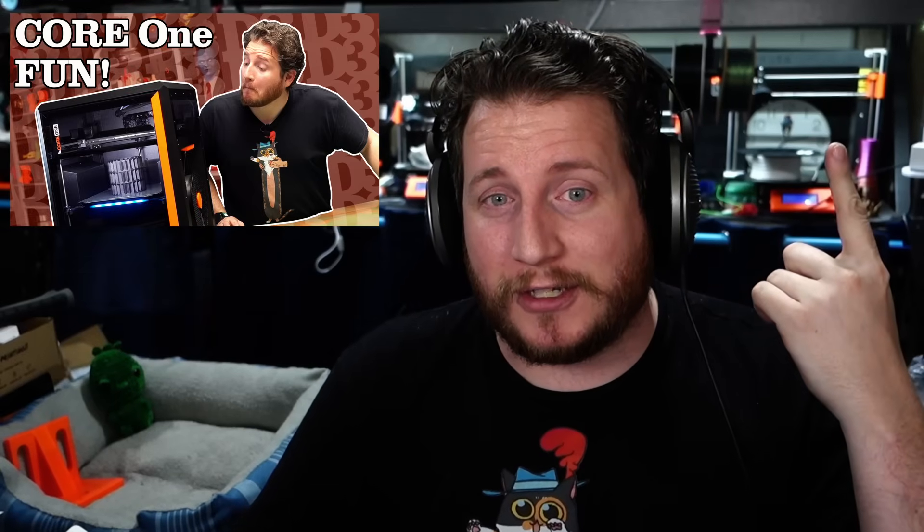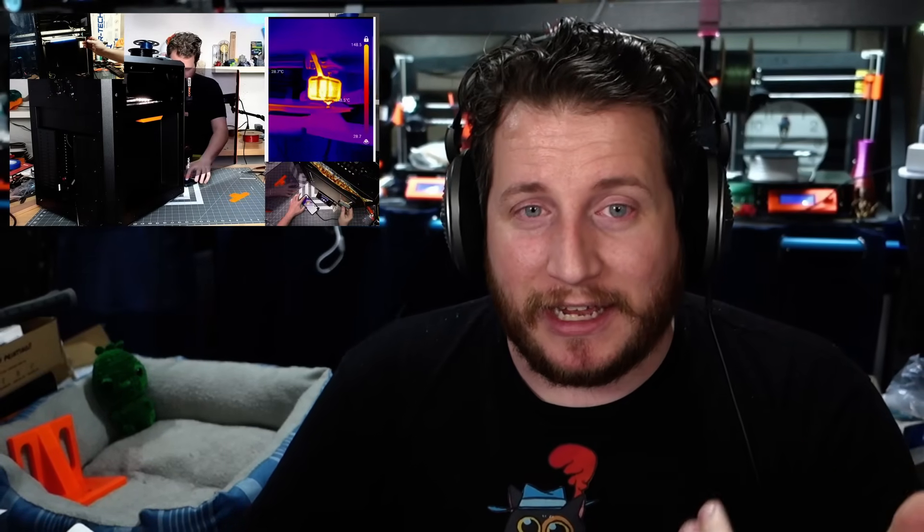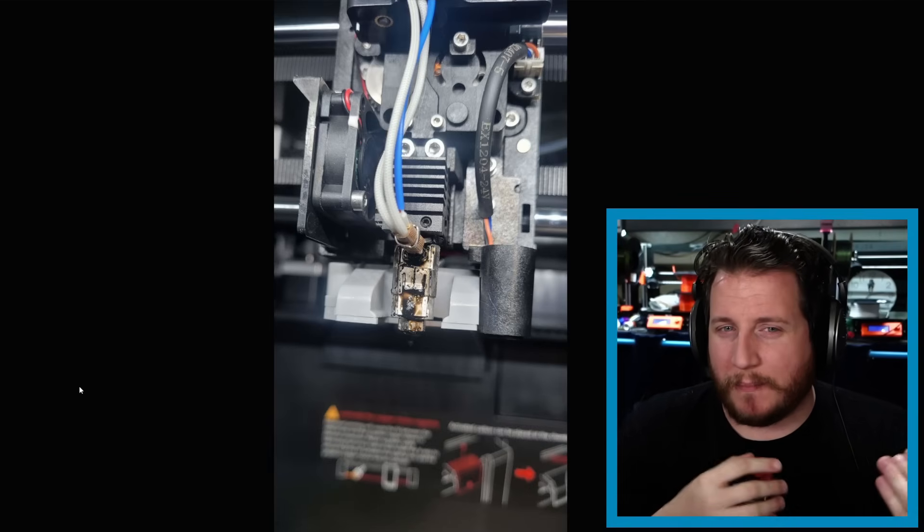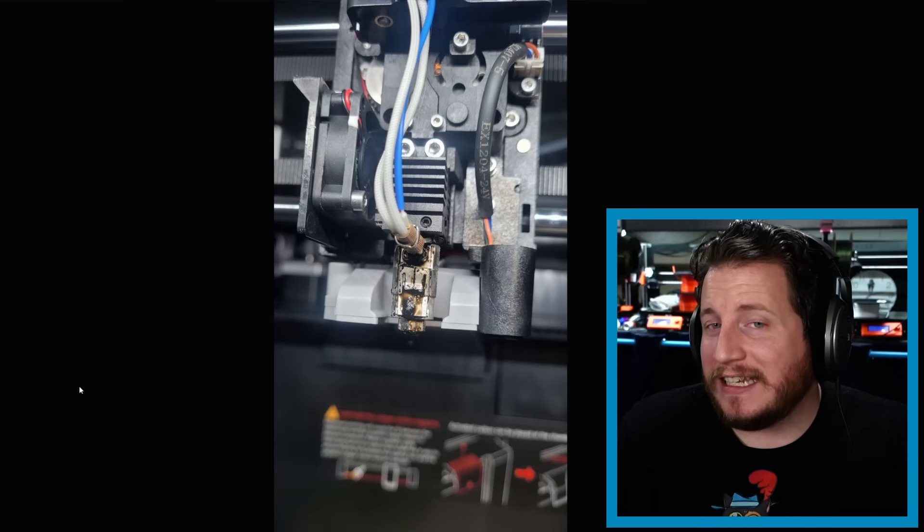This printer so far has been a pretty good machine outside of these two fundamentally game-breaking problems, and I wish it could be better because I do really like it. The chamber heater is nice, although I do wish it would automatically turn on the rear vent when the chamber got too hot. If I want to keep the chamber at 47°C, the bed goes to 72°C and the chamber will go above 47°C if the bed is left at 72°C — you can't stop it. Recently we bought a thermal camera to make sure issues like this don't happen anymore.